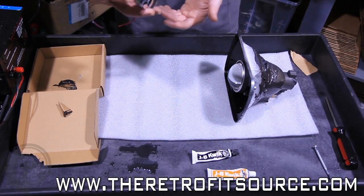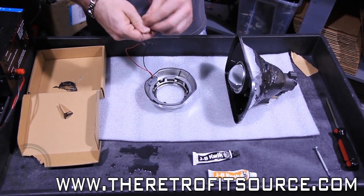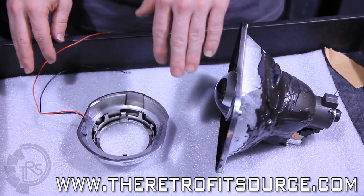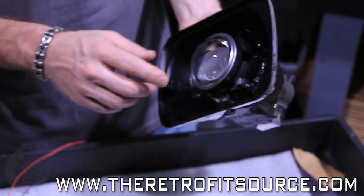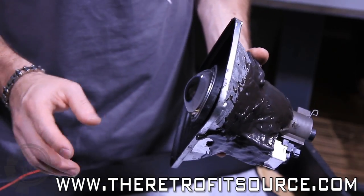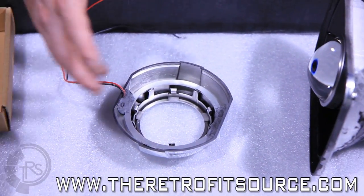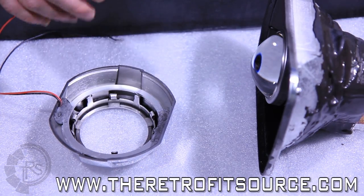We've got our shrouds fully trimmed up and ready to mount in the sealbeam retrofit. We already got the angel eyes mounted in there and de-pinned the connector for the angel eyes so we can fish the wiring through the housing more easily. We're going to prepare the shroud for its final installation onto the projector by cleaning the front lens frame of the projector with an alcohol pad, just to make sure the surface is clean and free of any contaminants that could prevent the shroud from sticking. From there we'll mix up our JB Weld, put it on the small fingers, and array it around the inside of the shroud so that when it's stuck to the front of the projector it stays put through road vibrations, heat, and everything else.